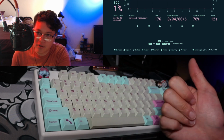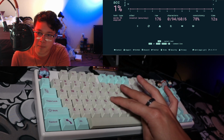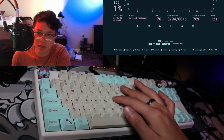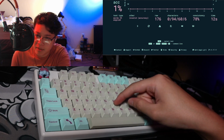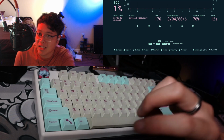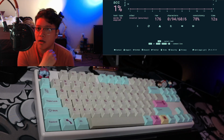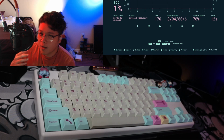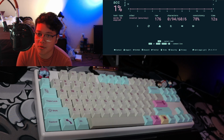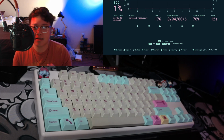Shine is when, first of all, the oil and grease from your fingertips, and second of all, the wear of your fingertips wearing off the texture of the material on top of the keycaps give a shiny look to them that looks very nasty. So people would usually gravitate more towards these PBT keycaps, so it doesn't get subjected to that much shine. But if it did, it would take significantly more time for PBT as opposed to ABS, which shines in a matter of a couple of months if you daily a keyboard. So yeah, anyway, that's another rant for another day.